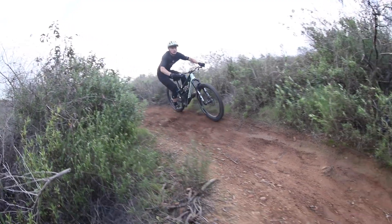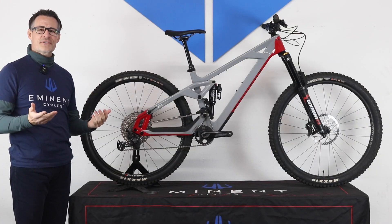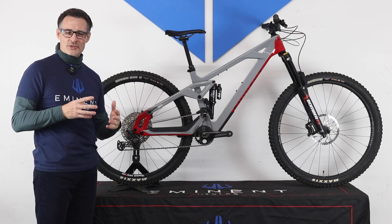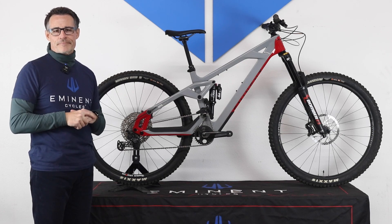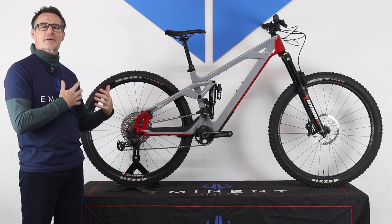We've tried a bunch of different bikes with axle path ranging as high as 40mm and as low as zero, and we found that with 15 millimeters you get a little bit of poppiness, better plushness, better traction, and you still get a bike that's got some liveliness to it. The further we went back, the more dead and flattened to the ground the bike felt — it just didn't have the excitement and the fun.